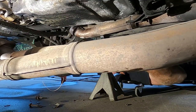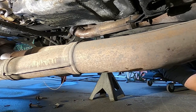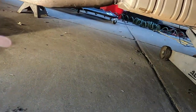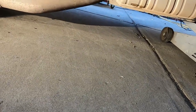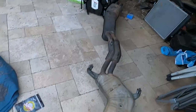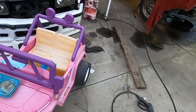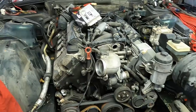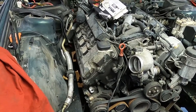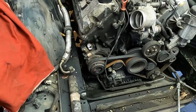Germany, all over the world, Russia — just dropped that exhaust. After a little bit of negotiating, we got the whole exhaust system out in one shot — got the O2 sensors and everything. Now I just need to disconnect the driveshaft at the guibo, then use the jack to support the trans, undo the engine bolts, and we're gonna lift it out.